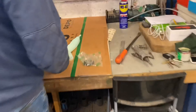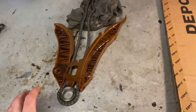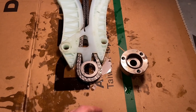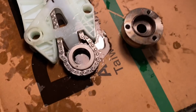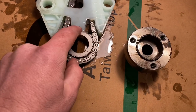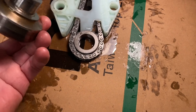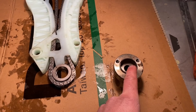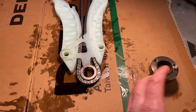We want to try and show as much as we can, and a lot of people do find it really interesting. We've got the old one there and we just put the new one next to it, pieced it together, copied it exactly. We worked out how this locates in the bottom, and as you can see it actually sits and runs — so we're thinking that actually holds it in place. I don't know whether to call this a bottom pulley or a crank extension — there's no keyways in this. So it is relying on that timing tool being in all three of those locking positions correctly, and then getting this on — the torque setting for it I should imagine is quite high, because that's holding it with no keyway. So we're going to move on, get this slotted in there, get it all lined up and start piecing it back together.